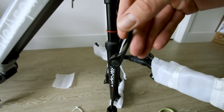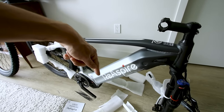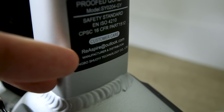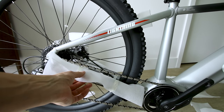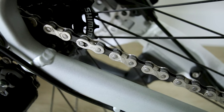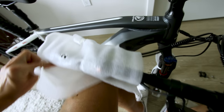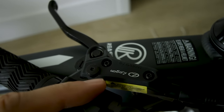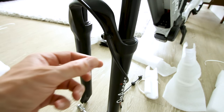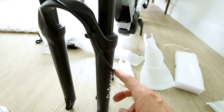The fork has basic suspension with a toggle switch for on or off, branded Reaspire. There's a quick release for the front wheel. Whoever installed the hydraulic brakes put the line on the wrong side of the fork — it should be routed inside so that if you tip over, you don't smash the hydraulic line and break it. But I'm not going to change it.